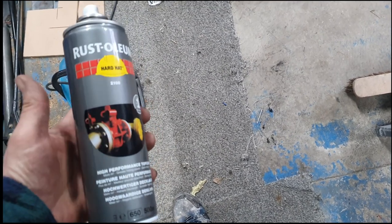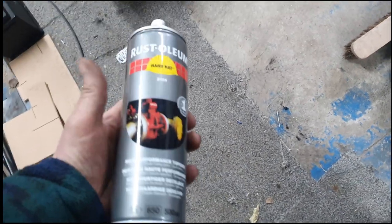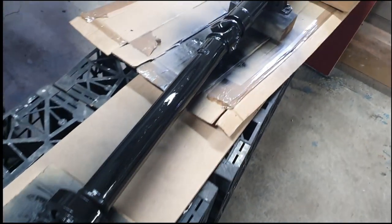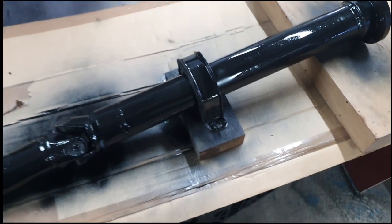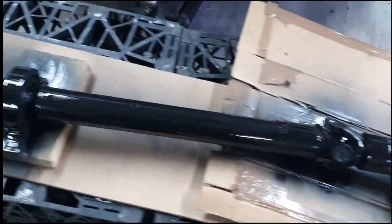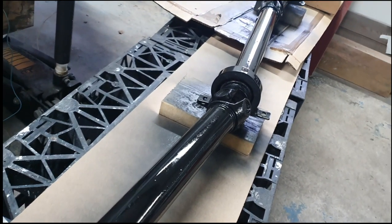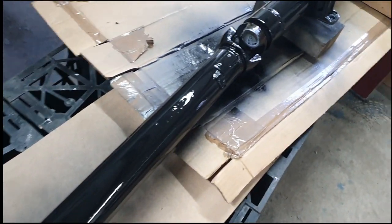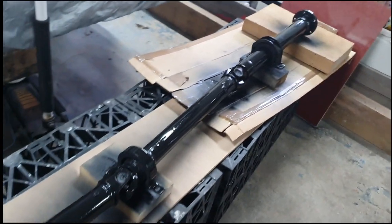This is what I've used for spraying — really good stuff. Industrial application paint basically, so it covers well and when you're spraying it you can get into all the nooks and crannies. And that is the end result — we have now got ourselves a nice sprayed up prop shaft. I've just got to let this dry a little bit and then I can move this up the shaft and spray the bit I haven't been able to get. I also need to turn the torque tube over so we can spray the underside. What I've done is set it on these blocks — a neat little trick — so you can just roll the prop shaft over and spray the other side as you work your way around it. Dead simple, and it means you can get all the shaft and all the universal joints done in one go.